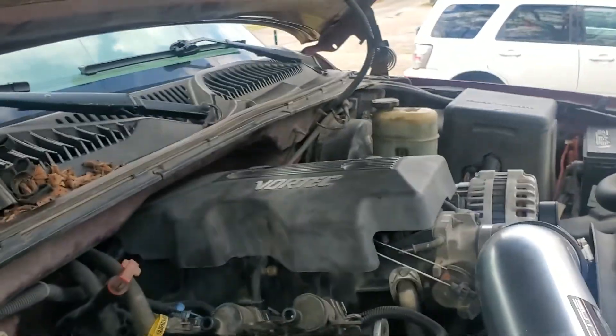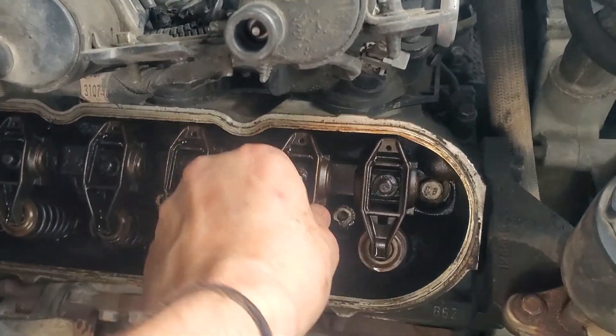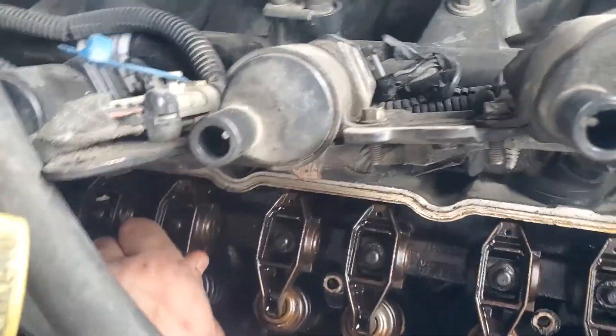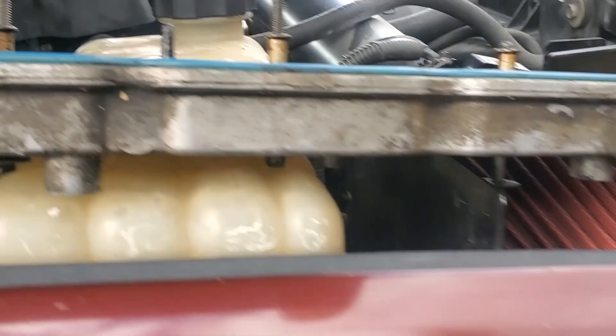Getting to the meat and potatoes of why we actually took this off — as you can see, there is no bad rocker arm on this side. I checked them, so that kind of narrows it down to EGR. The truck has a bunch of the same symptoms that correspond with EGR. I'm gonna check the driver's side just because I want to be thorough and I don't want to miss something and grenade a cylinder. But yeah, it's looking like it's gonna be the EGR, and I am going to get that block-off kit.